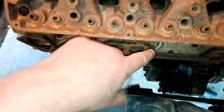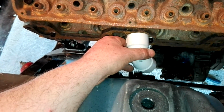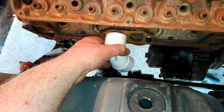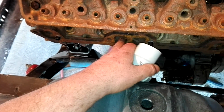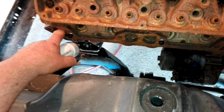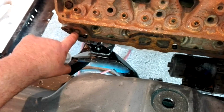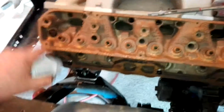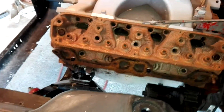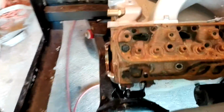So yeah, hopefully this week I'll pick up some short bits of tube to tack on there, a bit of 40mm exhaust tube. I'll end up hopefully making these 1 3/4 primaries. I could probably go out to 1 5/8, but I think because I'm going to have to make these bigger anyway to fit my heads, because they're so heavily ported on the exhaust side that these are actually smaller than the port without actually putting the piece of pipe in there. So I'll just get a bit of 40mm that suits these to start off. It's going to give me plenty of dimensions anyway to make my headers off when I make my jig.